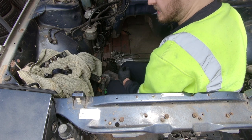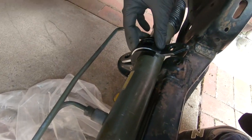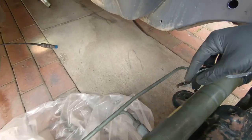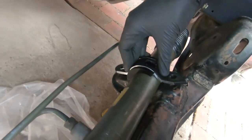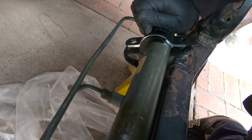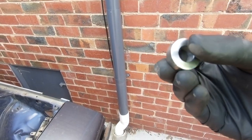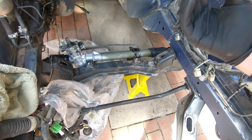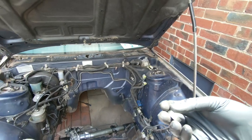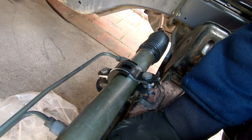That's not as close a fit as I imagine it's intended to be. The interesting part about the S12 bracket is because it doesn't wrap around as far, it's going to need some heftier spacers to reach it. You can see the gap now. So I'm going to get some really long M10s as well as some decent sized spacers. This is the space that you get with the solid mounts — it looks like I'm going to need two of these, if not more, either side. I've grabbed some longer M10 bolts and I'll measure up the actual space to figure out what size spacer I need.